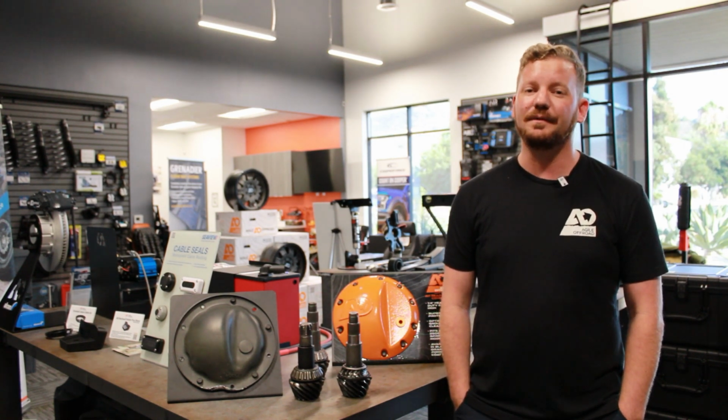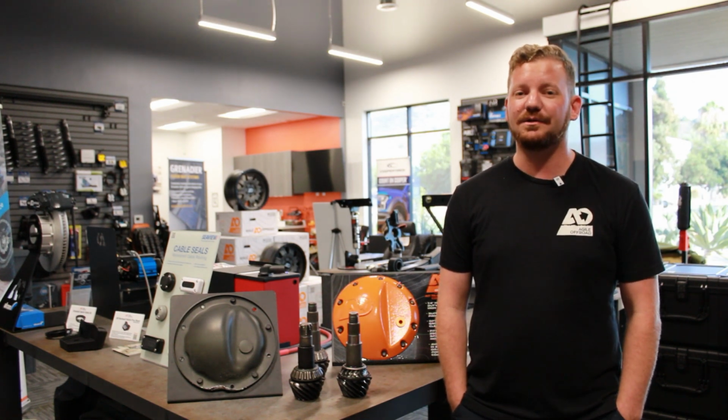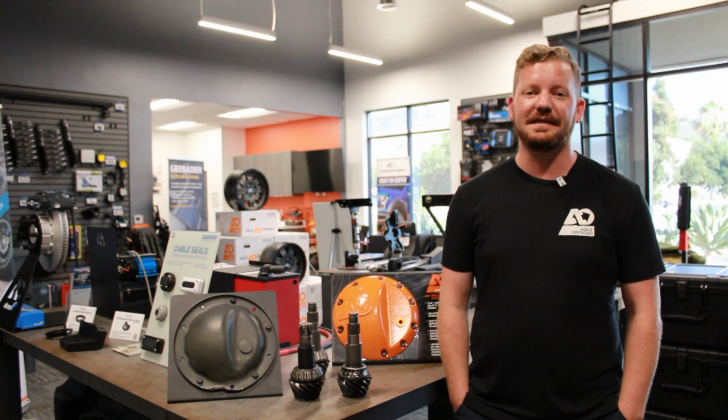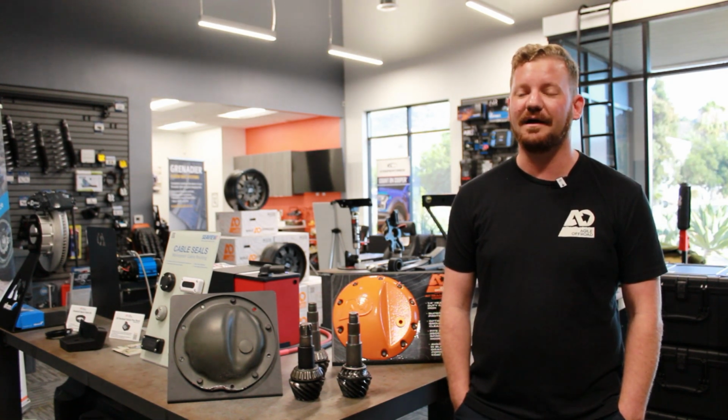It's also common when you jack the van up from the rear differential incorrectly. If you know what you're doing, you can jack the van up from the rear diff without damaging the cover, but the safest thing is just to fix it at its source, replace it with a cover that doesn't have that little lip hanging off of it.